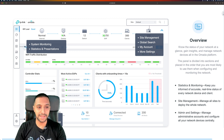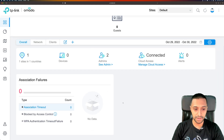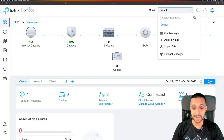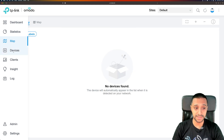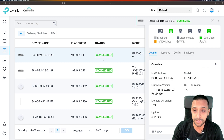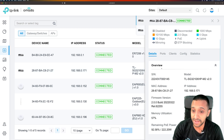It shows you a quick overview of the system and how to work the interface. Click the little X in the top right-hand corner and here we are. The dashboard shows you what's connected, how many devices there are, and any associated failures. You have your profile in the top right-hand corner, your preferences, and your site — you can have multiple sites. There's a hotspot manager, which I'm guessing is for your guest network. There's a stats section and a map — no map just yet because there are no devices placed. If we go ahead and click on 'Devices', you can see these are all pending adoption. Click the arrow at the top and give it a few minutes for them to adopt.